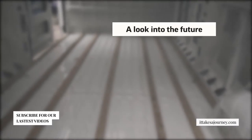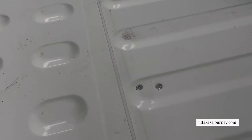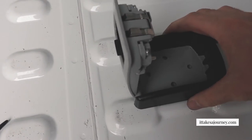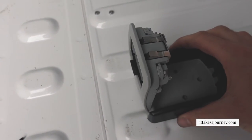We're going to avoid the battens that are running across here. We have got our flooring battens down and they're running along this one with the actual screws. We're going to be installing it just here because of this little inlet in the structure - it means all four screws are going to sit flush to the bottom of the van, or bolts rather, without having to go up any of the lips. I've marked the four little screw holes out.